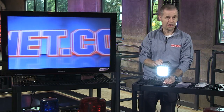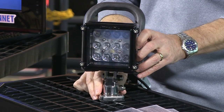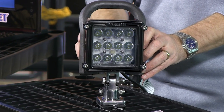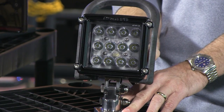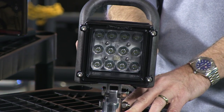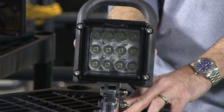It has a total of four different lenses, so let's take a quick look at those. Moving it around here, you can see a close-up of how the diodes are placed inside. Using Whelan's patented deep dish technology, you've got gen 3 diodes in position with an additional diffuser mounted in front of the actual LED itself, which bounces the light back into the deep dish reflector.